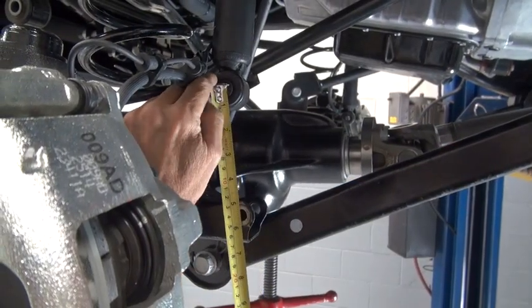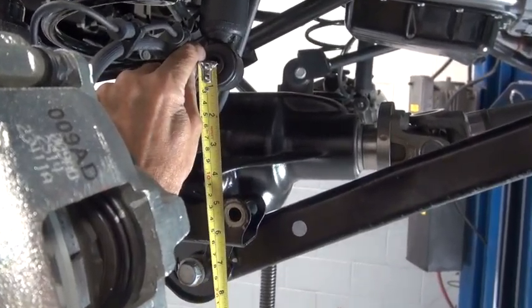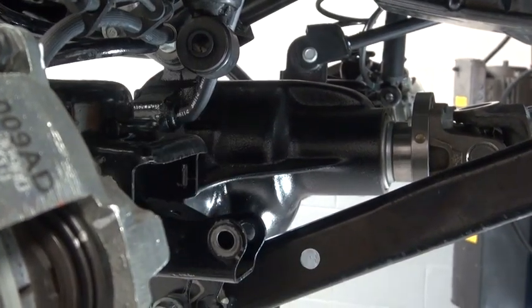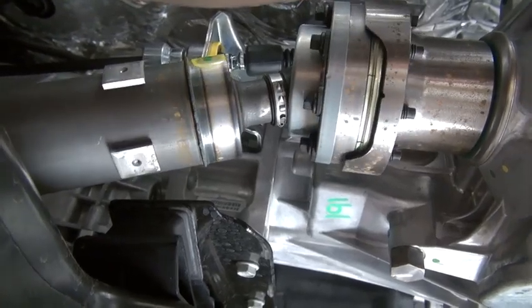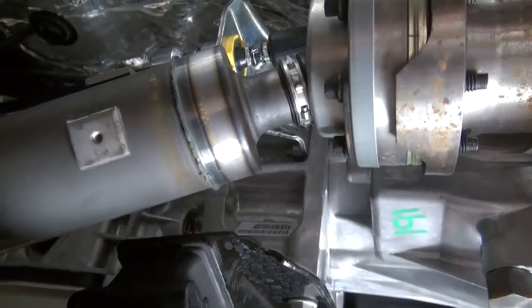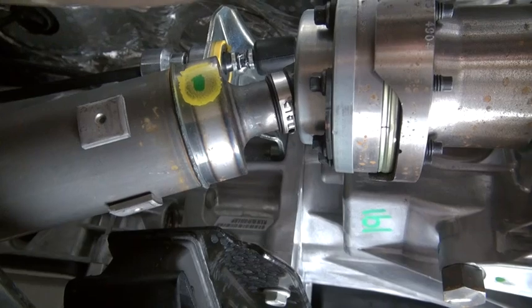As we lower the axle down, we can see that we can now measure a little over 5 inches of droop. We started out with only 2 inches before we ran out of clearance — we've gained a little over 3 inches. It's important to note that regardless of what we do suspension-wise or with the exhaust, we have pretty much maxed out that driveline angle. We can see that the driveline cannot go any further without cutting the boot. If you lift your Jeep more than 3 inches, you will definitely need to replace that front driveline.